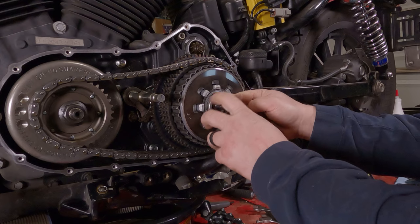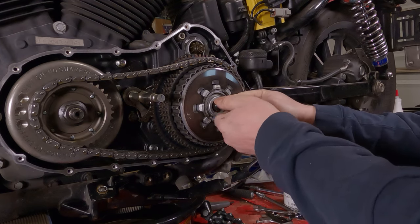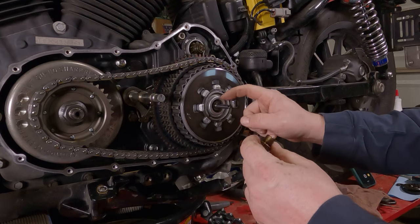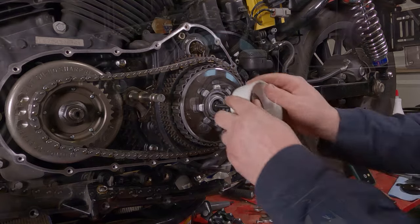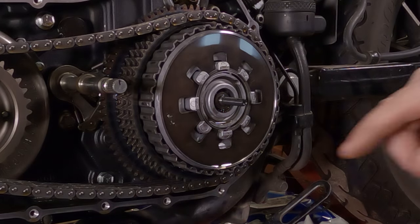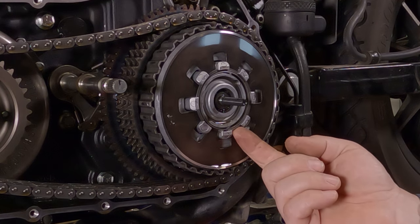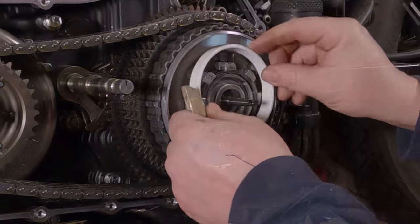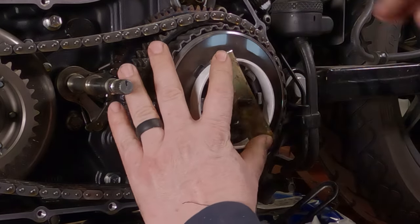So you have this little hex spring nut, whatever we want to call it, that the spring goes over top of. This was part of your clutch. It's the same thread as this shaft right here. So we're going to use that as like our jack bolt. Our goal here is we're trying to take off this outer snap ring. We're going to have to push this pressure plate in, then take this snap ring and flick it up. Take your now shortened PVC disc. Take your little metal spanner there.